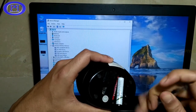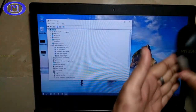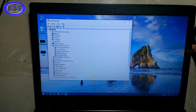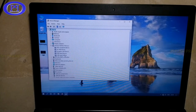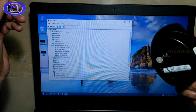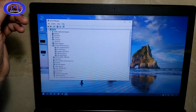The connectivity between the mouse and adapter is not proper, likely due to weak battery strength. I can see the LED on the mouse is glowing, but not glowing properly, which is why I suspect the battery. I'll need to grab a couple of new AAA batteries to verify. For now, let's move on to the teardown portion of the video to see what's inside this gaming mouse.